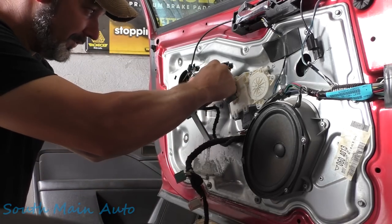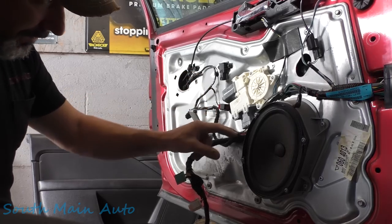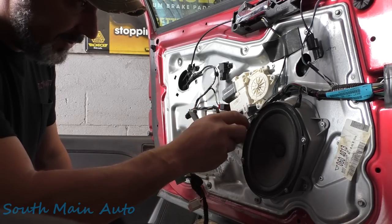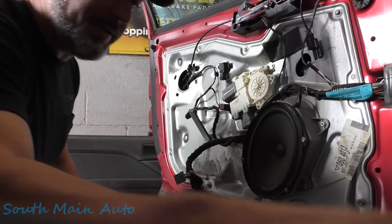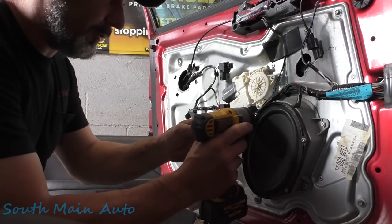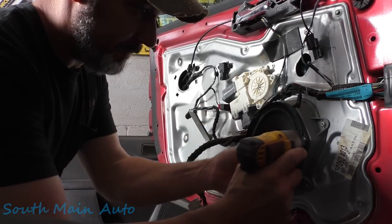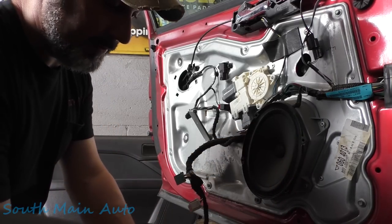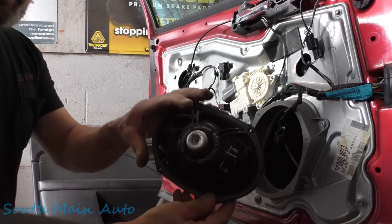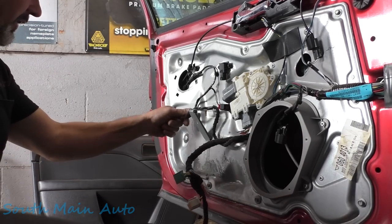Just make up your own stuff, call it what you want — some people call them door handles. Unplug this little fella. So that's just the outer case. We've got some Torx bits there, so we can take that off. If that's all riveted on, that's kind of a pain. We'll just use our little Torx bit here. Take our speaker out — we need to unplug it. We'll set those screws down here. Unplug that baby. She's a woofer — woof woof. We can take the door handle off while we're right here.